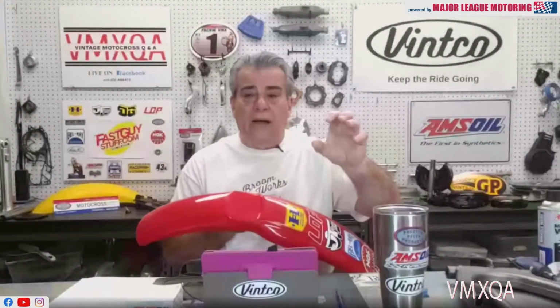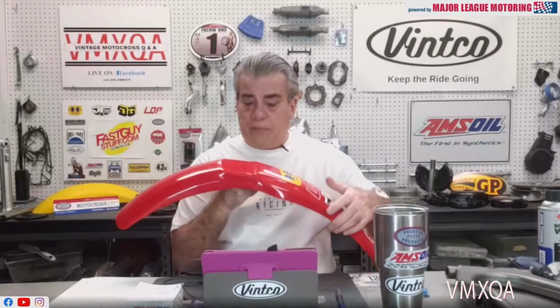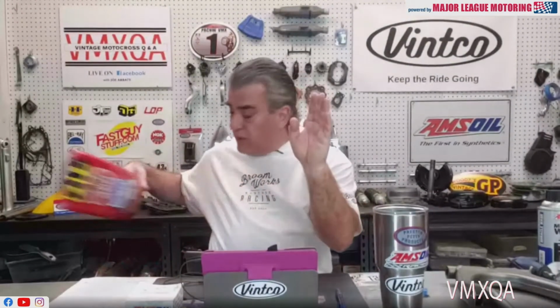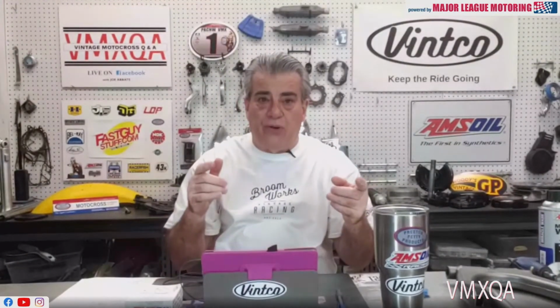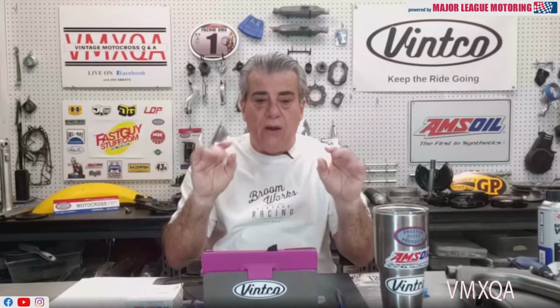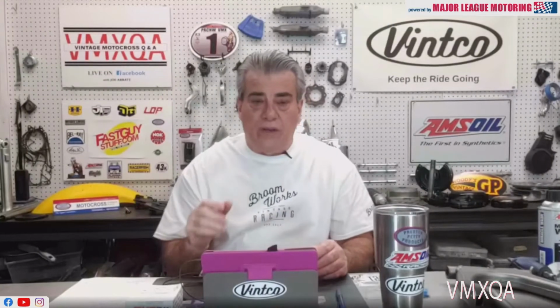the washer and the grommet. You can put your screws through there and you can put it up and see on the bike that everything lines up. If one of them happened to be off a little bit, you've only drilled a 6 millimeter hole in there, you can still make a little alteration for that. And if you have to move your fender a little bit to the front or a little bit more to the back, you can do that, because you're gonna be using a step-up drill to make that hole bigger in order to accept your grommets. But at that point, with those 4 6-millimeter holes in there, you'll be able to put the 4 screws up and see that your fender lines up exactly with the triple clamps.